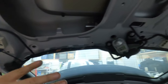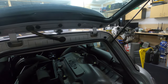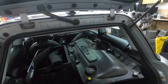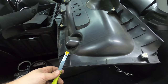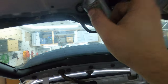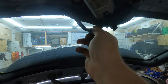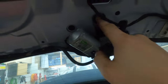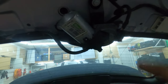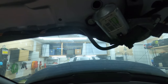We got our trim panel popped off. I just used a pry tool — the edges are real thin and can get behind panels easily without potentially scratching things, and you can also use it to pop clips back out of the body if they get stuck. Now that we got our panel off, we have access to our rear wiper motor. All that's left is to pull our washer fluid hose line off here and undo these three 10 millimeter bolts under our plug connection. The plug connection just has a little locking tab that you press in and pull out. Take out the 10 millimeter bolts and the washer fluid line and pull our wiper motor out.